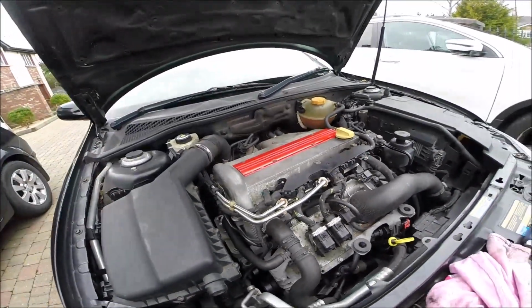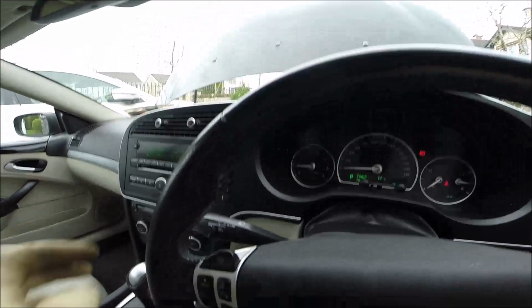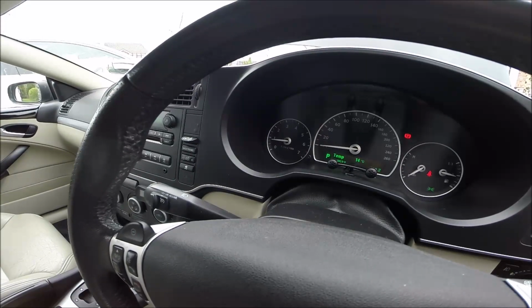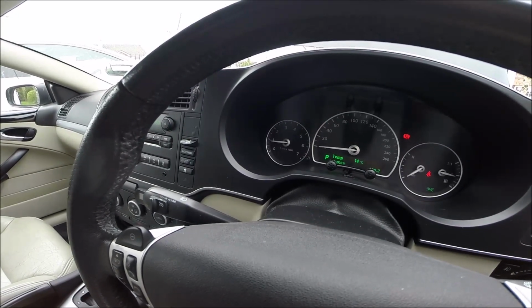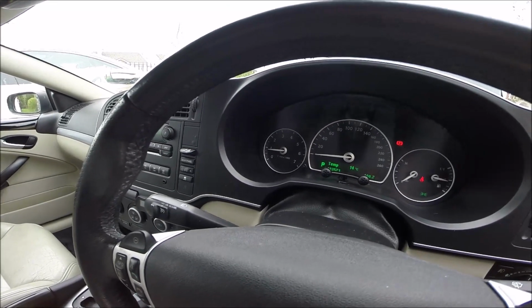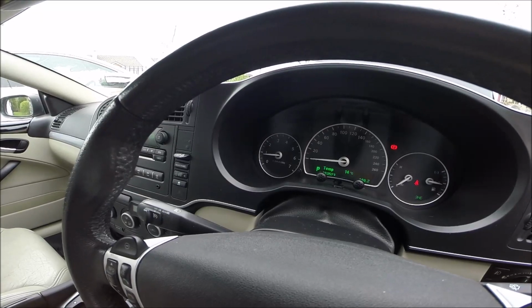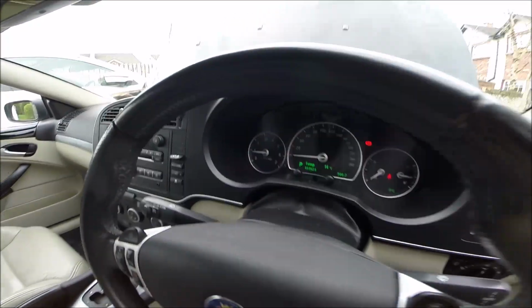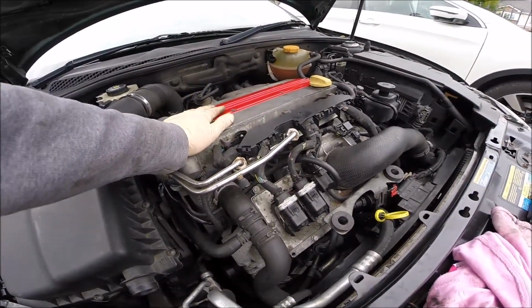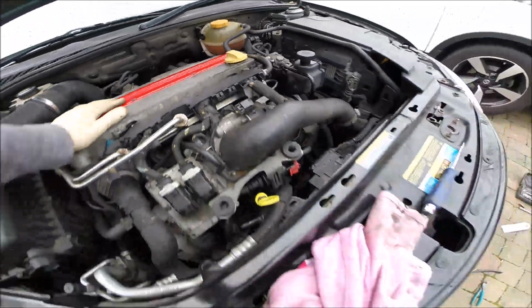And all right, so the car has idle at the moment. This is not the low idle, so we don't yet feel the misfiring. Now it is around 850 or 900 RPM. When it gently goes down to 720 or 750, I start to feel the misfiring. So that's funny, the engine is running not too bad. Okay, alright, I'm still sure nothing leaks.